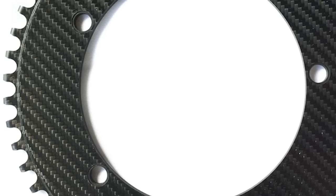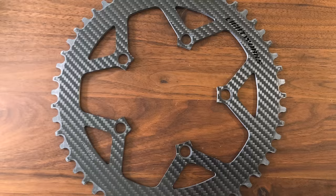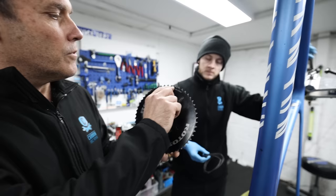I don't know what they're thinking making chain rings out of carbon fiber. I'm sure experimenting with carbon is fine and you try to get the bike as light as you can, but chain rings are just a no-win situation. Carbon fiber doesn't abrade well — it just turns to powder because it's so hard. The tips of the carbon ones are the first to go.